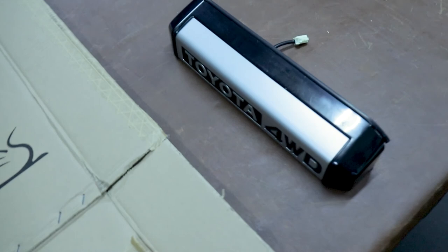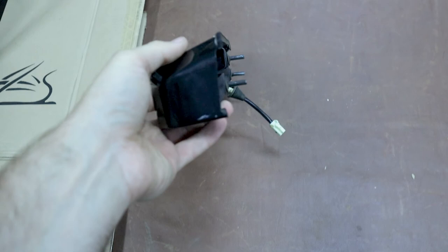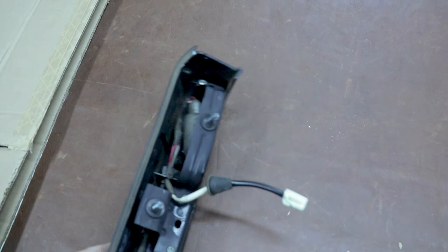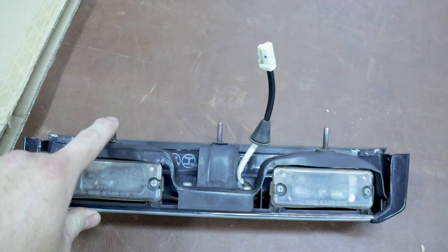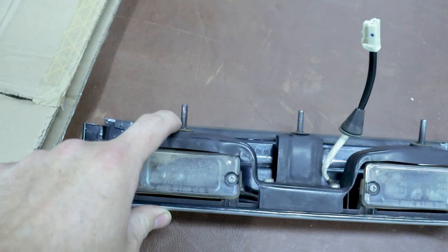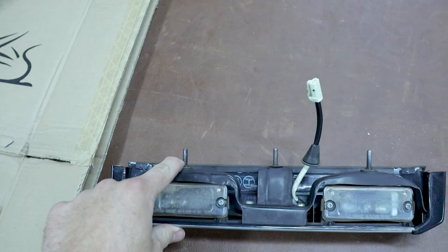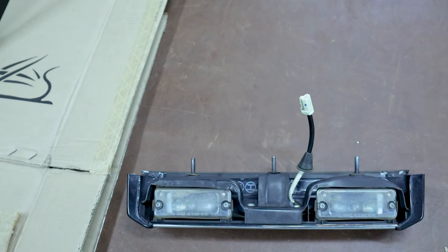Okay, so this is the handle that normally goes in the back door. So we've made a couple of changes here. Not we, my dad's made a couple of changes. I don't know if the camera will focus. There we go. So we've cut that out there to make up for the thickness in material over here on the ladder. And then also we've taken out these standard bolts, because the standard nuts strip off about 5 mil of the thread, so you actually can't get another nut on there once you've taken them off. They're also very short, so you can just barely get an M6 nut to take on them. So they've been taken off and we've replaced them with these stainless steel M6 bolts.